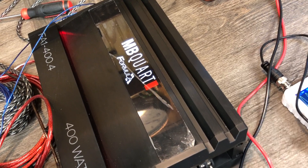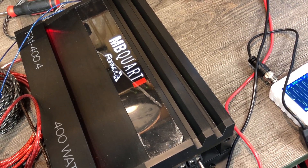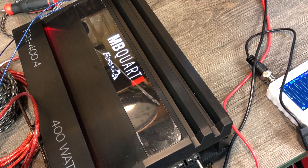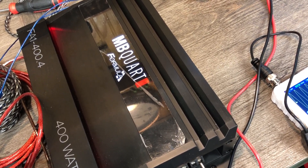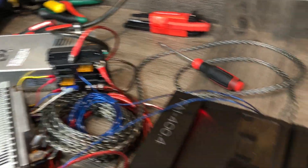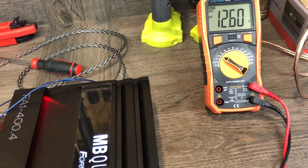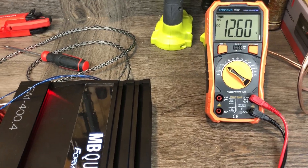I don't know the exact wattage. Digital Jake suggested that we hook up an oscilloscope and check the voltage coming out. So that's what I did. I've got the power supply over here outputting 12.6 volts, which simulates the car with the engine turned off, just running on battery.